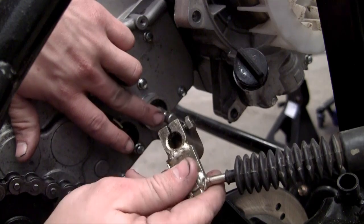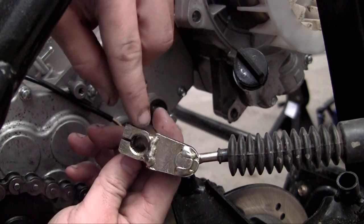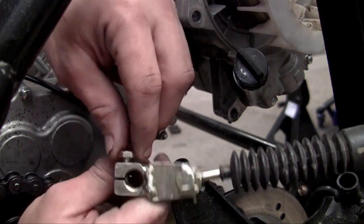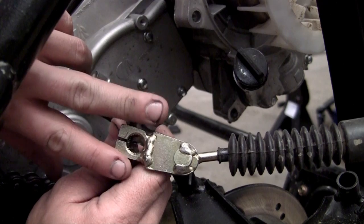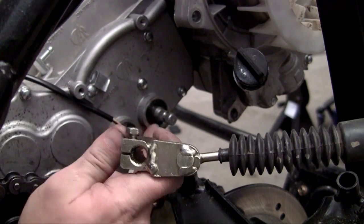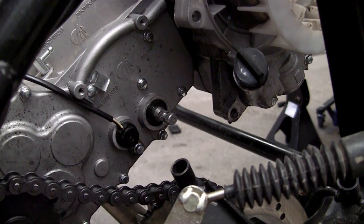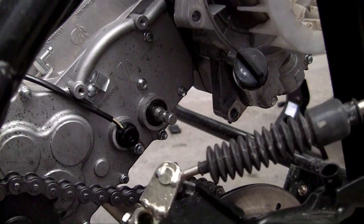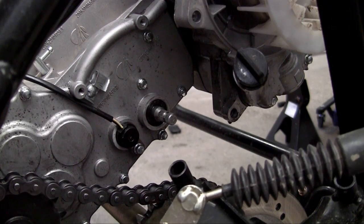There are little teeth in there — it slides perfectly over this and then you need to tighten it down. When you first put it on it's nice and loose, so you tighten it by tightening this bolt. Whenever you do that, it pinches together and clamps down on this little nub — your transmission. That's basically the only two pieces that you need to install your transmission: the lever that the driver pulls and this connection right here.